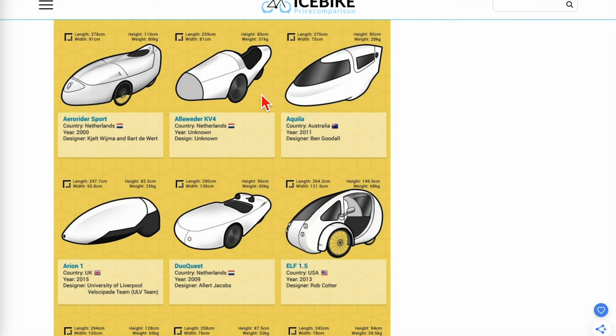The most notable early model is this Dutch trike, made of full aluminum. The original idea, as the name suggests, was all-weather — creating a bike or trike that people could enjoy in winter in the Netherlands, Germany, and Scandinavia. They discovered that this housing, though heavy at around 50 pounds for the average Velomobile today, also makes the ride far more aerodynamic. As it turns out, air resistance is about as important as the weight, if not more so.